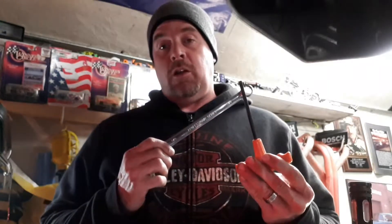We're going to need a 5/8 wrench for the drain plug — I will be torquing that back in. You'll need a T27 for your primary housing cover. For the clutch adjustment and cable adjustment, you need a half inch and nine-sixteenths wrench, an eleven-sixteenths, and a T27 for the actual clutch adjustment.